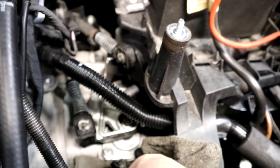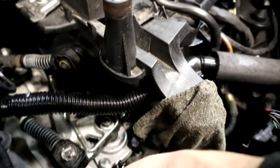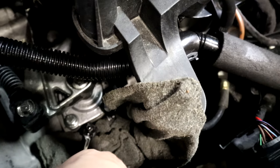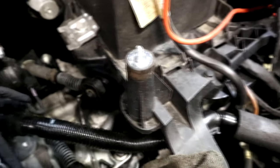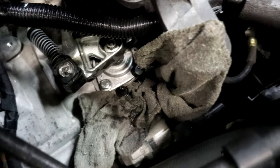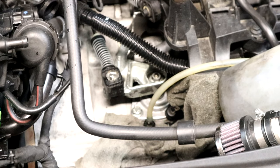I went ahead and cracked that. The pedal always goes to the floor and gets stuck — that's just what it does. Now that it's to the floor, go ahead and open your bleeder screw. It's a 9 millimeter. And there's a squirter — that squirting was from me stepping on the clutch. Stick that on there so it doesn't make a mess.